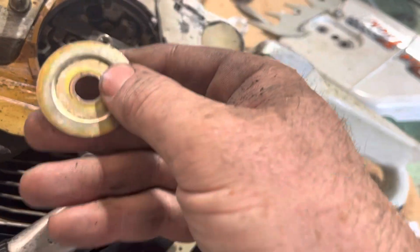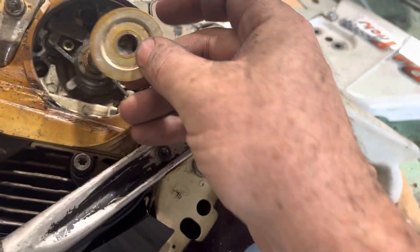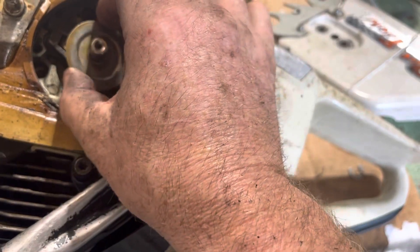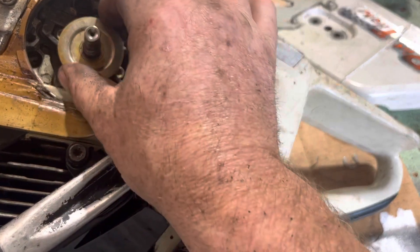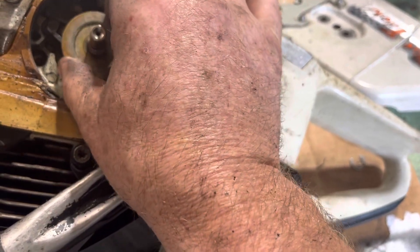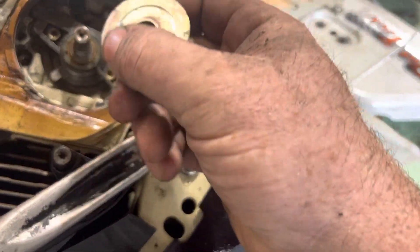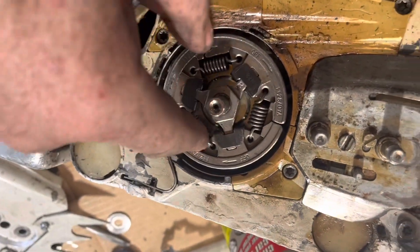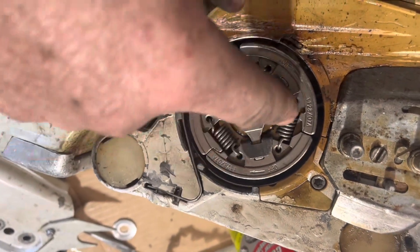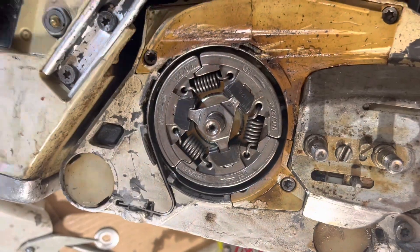If you flip it the wrong way so that the disc or press piece sticks down, you'll find that your clutch hangs up and won't sit low enough. These normally have an arrow on them, but just remember that when you tighten them back on, it's actually lefty-tighty — the reverse thread.